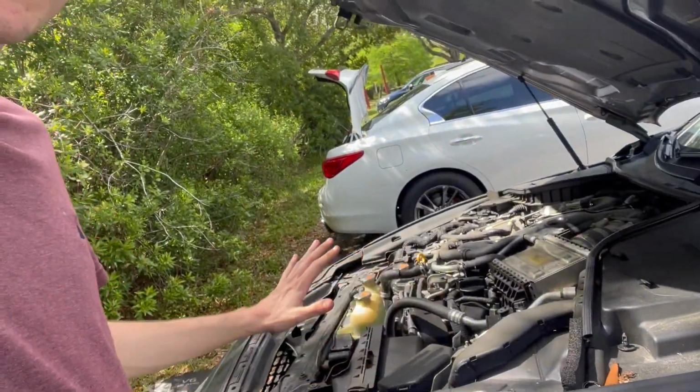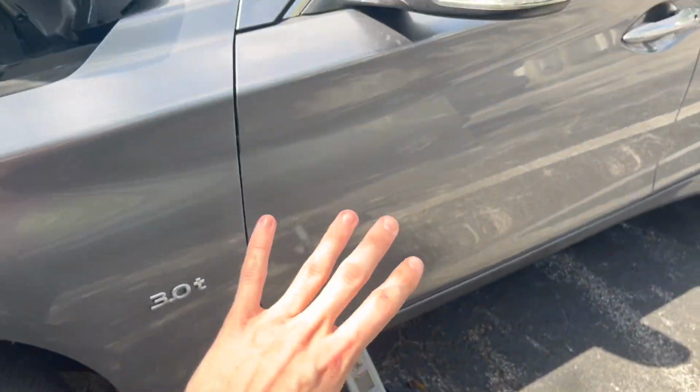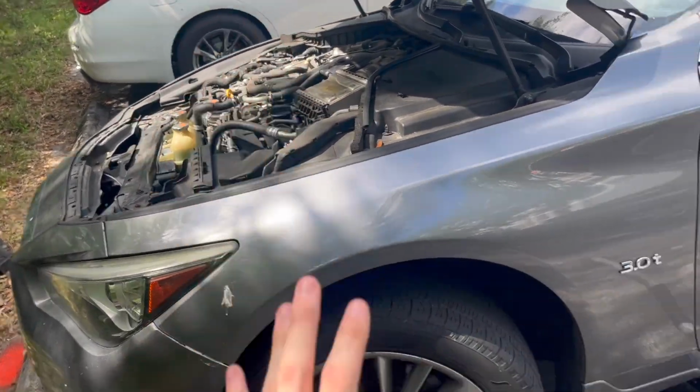As far as draining the coolant out, there's a very small screw valve that you use your hand to undo, and it doesn't come out very quickly. That being said, before you move on with any of the top end stuff here, go ahead and jack up the vehicle and get the coolant draining, because it takes a very long time. The best spot to jack up the vehicle is from the driver's side, because the drain is on the passenger side, meaning all the fluid's going to be pushed that way.